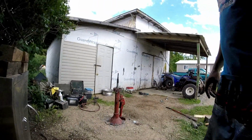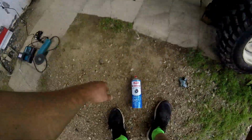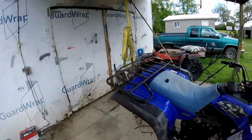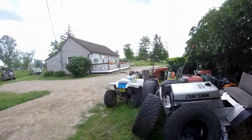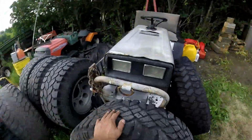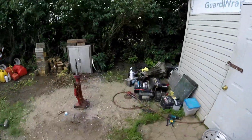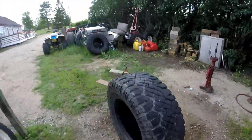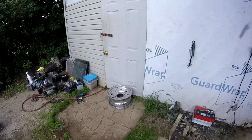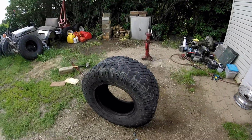Guys, that's how you put the tire on. You need to buy some good old brake clean, non-sponsored, and get a long stick with a rag, spray some on there, and fill up the tire and rim with a little bit of brake clean, a couple seconds, like 5-6 seconds. Make sure you force some air through it, because it's not going to make a little explosion if you don't do that. Next, I'm going to take this tire and put it on that rim, but it should be easier because that rim is only an 8-inch, not a 10. So yeah, I get to doing this.